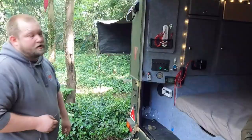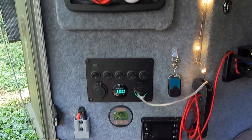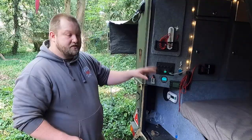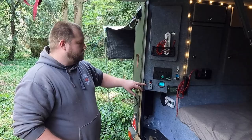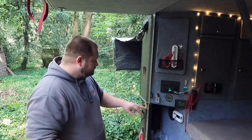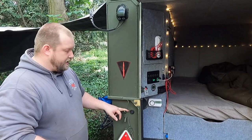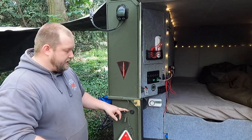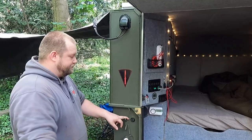On the left-hand side I've built the control panel — the best place to put all the electrics for the trailer and make them easily accessible while standing outside. There's a battery monitor showing the current state of the battery. I've got a direct line to the battery through an 80-amp breaker. On the side of the trailer there's a magnetic power port — when it gets home in winter and the solar panel can't generate, I just plug in a magnetic charger to the house and it automatically charges the batteries. I made it magnetic so it just pops off if you drive away while still plugged in.